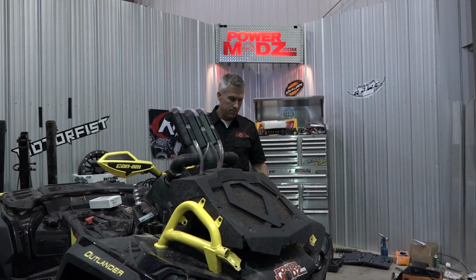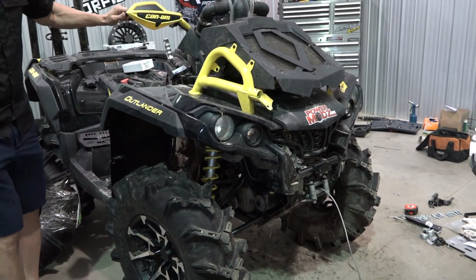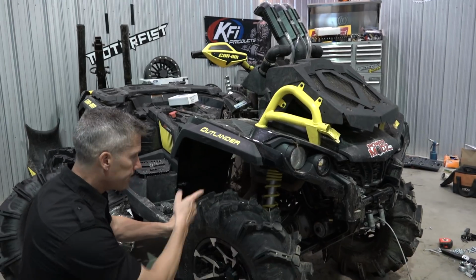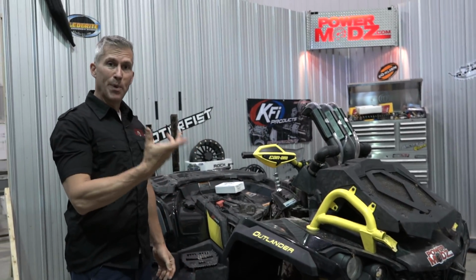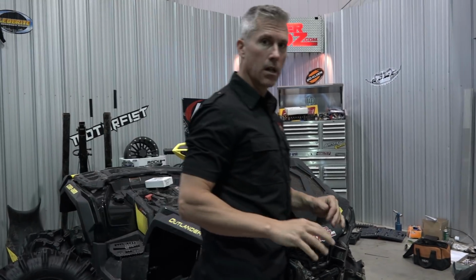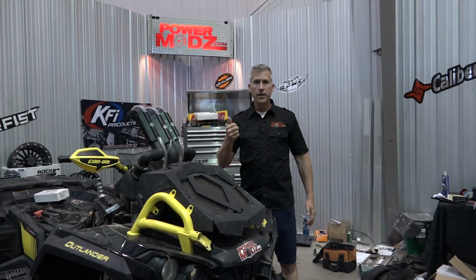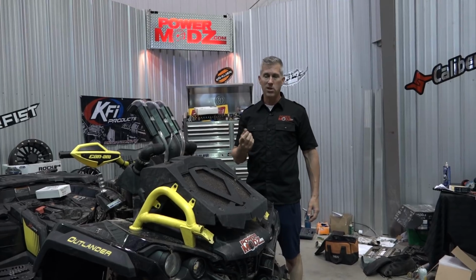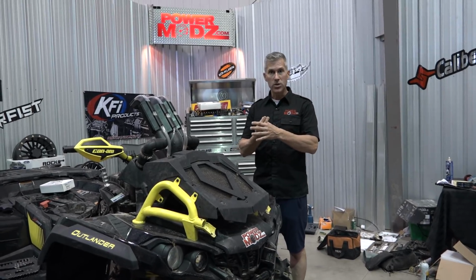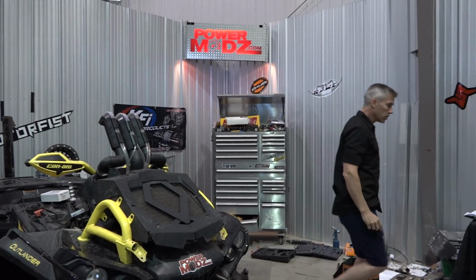But if you look at this, look at the handlebars. That tire's not moving. That one's not moving either. And watch this. You can't really see it very well in there, but there's a tie rod end that attaches to the pitman arm that constantly comes loose after 20 kilometers. That is loose. There's a cotter pin on top of the stud. There's no castle nut. It's just got a lock nut, and it's not a tapered tie rod end that goes up through it and pulls in and locks right up. It's actually just a hole, and I'll show you.